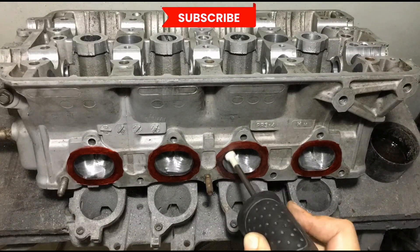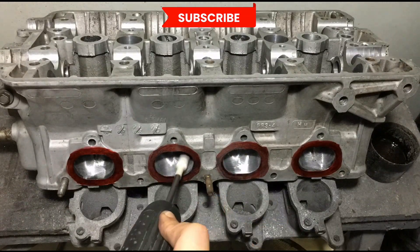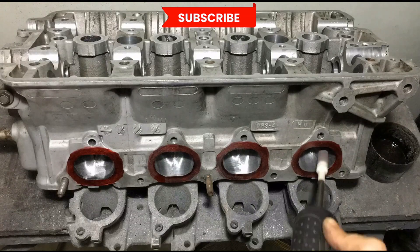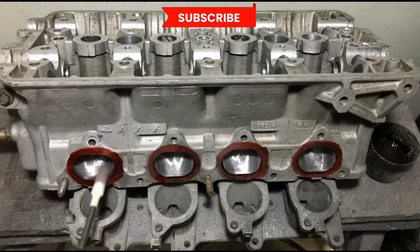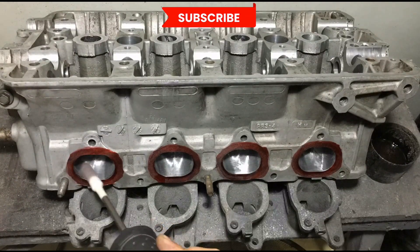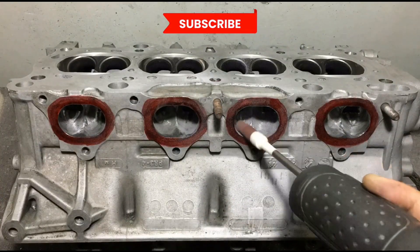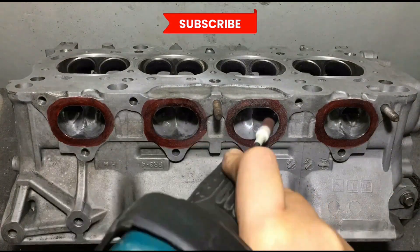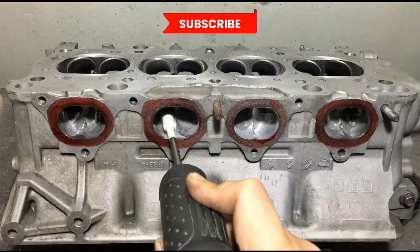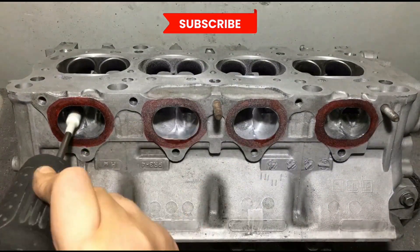Here we are with 120 grit, and you can see it's getting smoother. You can stick with 80 grit, but it'll just remain a little too rough. But if you jump straight away to 120 grit, it might take forever — it might just take too long, you get tired, lazy. That's when mistakes happen, so we avoid that. The 120 grit really helps us smooth the texture and actually lets us feel it. If there are little bumps or unsavory shapes, we go take care of it, and we just continue until we get the desired finish.